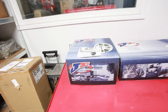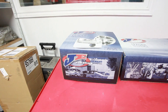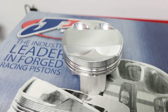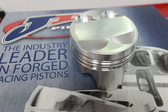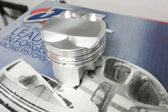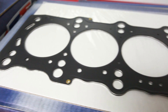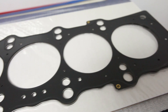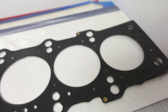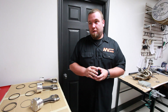We're here for the 2JZ build with JE pistons — they sent us the good stuff. These sexy slugs of high tensile forged aluminum are designed to withstand high boost levels, and the new asymmetrical skirt technology reduces friction and mass while providing a stronger platform. This Pro Seal multi-layer steel gasket is also ideal for high boost applications, since its unique soft radius embossments improve gasket conformability, reduce stress points, and provide a more uniform clamp load distribution.